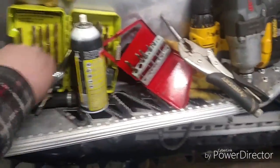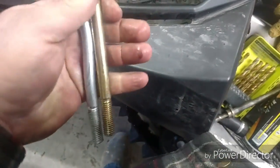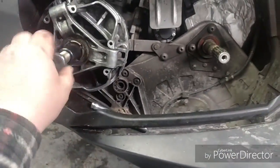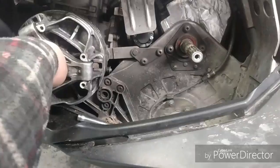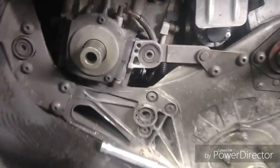So I went ahead and tried it with a grade 8 bolt. That's what I just did. I stuck the grade 8 bolt in there, but the grade 8 I had was shorter, so I had to cut a chunk of 5/8 round stock to fit in there. And I impacted this bolt in there, and did some light tapping on it with a 3-pound hammer. And it finally popped off. So hopefully, in all that, I did not mess up my threads in there.